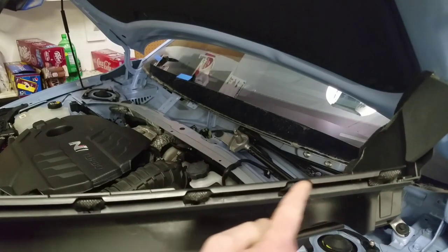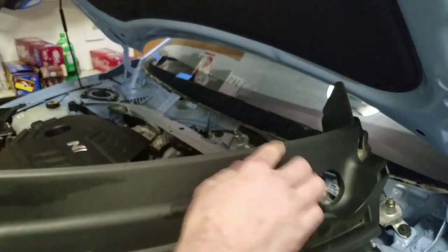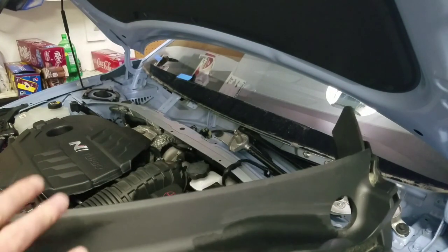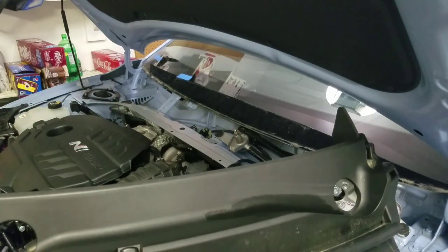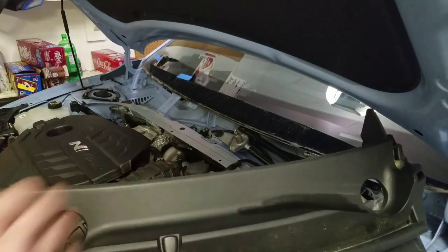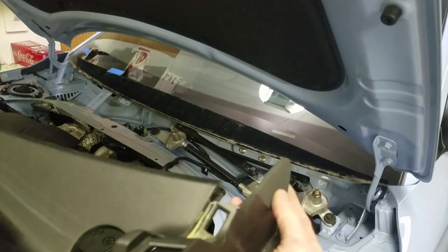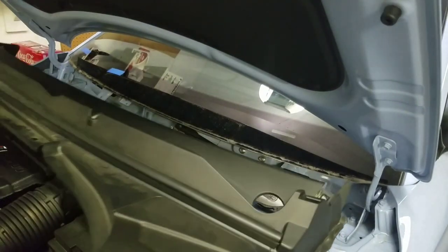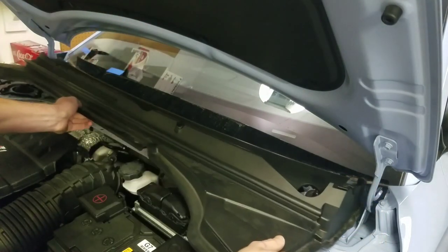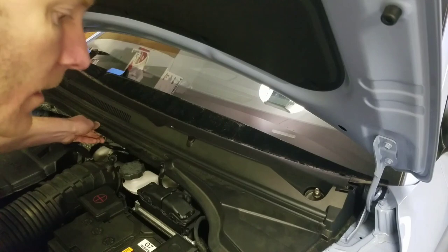Your windshield is going to sit in the seam right here, so you're going to want to put that in at an angle. As you can tell, I did go ahead and get that bird poop out - pesky little birds. Bird poop is not good for any paint or plastic, just clean it up if you see it. Let's go ahead and install this. This piece right here is like foam and is going to slide underneath. I'm taking that tab and sliding it underneath the windshield, and we'll get this in place relative to where your holes are for your clips.